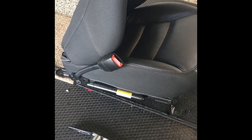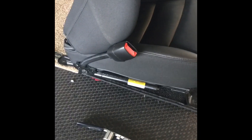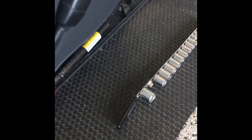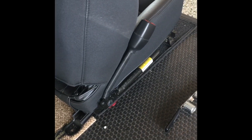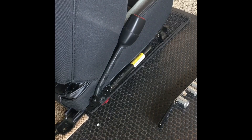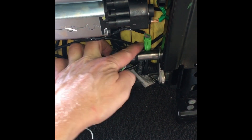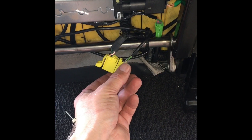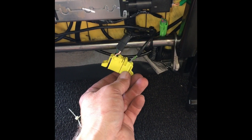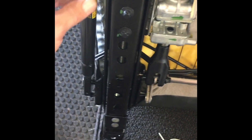Not as many sensors and harnesses, thankfully. I just have to remove this buckle with the pre-tensioner. It says on there to be very, very careful not to hook it up incorrectly. If you do remove the wires that are attached, disconnect the plug so you can feed it out through, then reconnect the wires into the plug — make sure the wires are on the correct side of the plug. The pre-tensioner wire comes down through here and gets hooked up with the airbag harness. Thankfully this clip can detach — this clip stays with the seat, this clip detaches and goes to the harness. Disassemble the clip if you feel safe, pull the wiring harness out through the seat, and you're good to go.